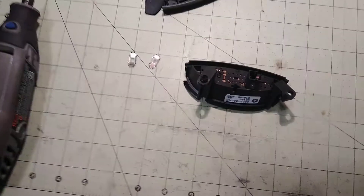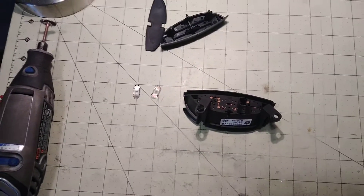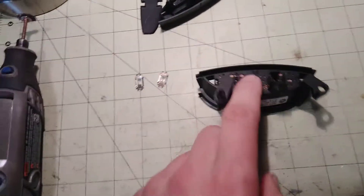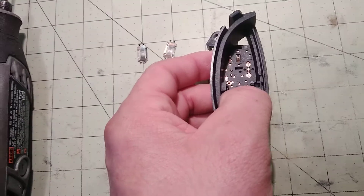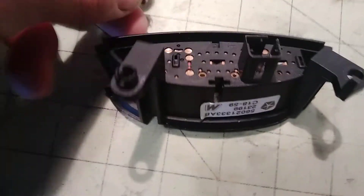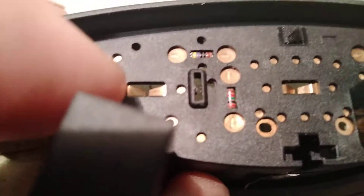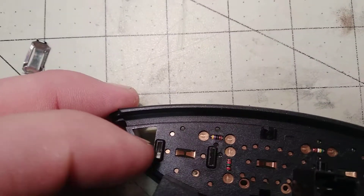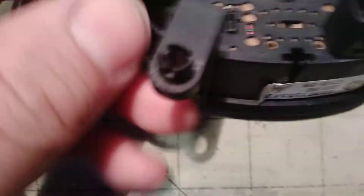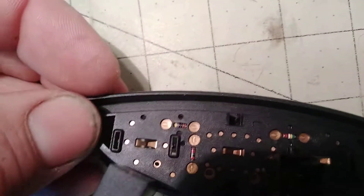So I think this pretty much takes care of it. This is how to clean the switch, a little bit on the bulbs, the part number for the bulbs, making sure they're not burned out, and then testing for power. From the wire coming out of your clock spring — I still need to clean the other switch; the other switch will have three contacts. When you open this up, you don't really need to take the switch apart. You can just look and see when you pop these plates — they pop into these slots — and you'll be able to see if it looks corroded or isn't getting a connection.